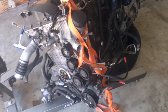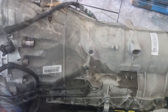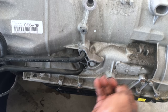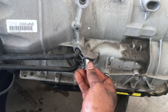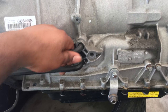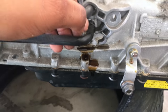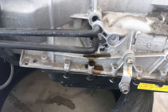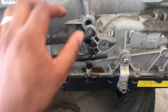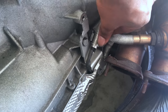I'm gonna go ahead and start pulling the transmission from the engine. First I'm gonna pull the transmission cooler lines off the transmission using a 13 millimeter. Once the screw's out you can just pull it out. You should have a rag or something ready so any fluid that's left in there will leak onto the rag instead of on your floor.